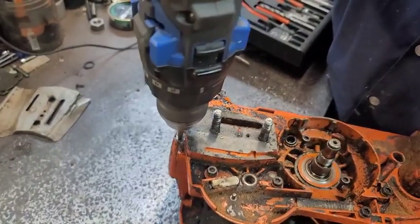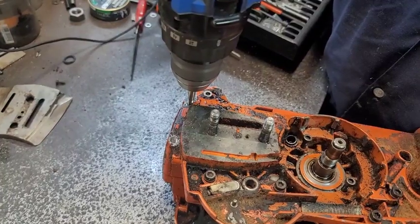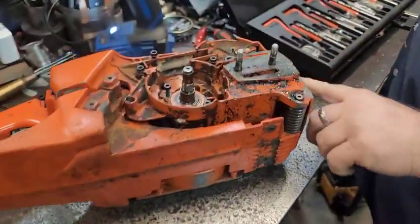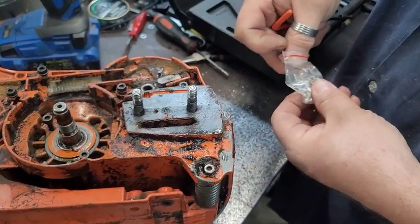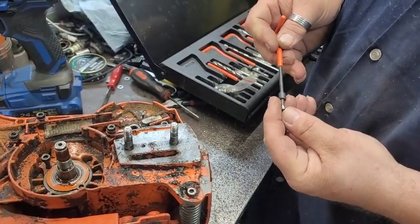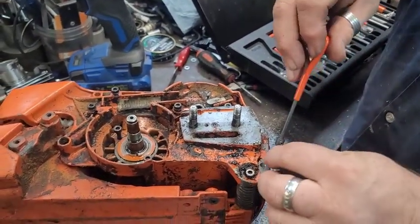I know these cases are nasty, but I wanted to try to get them repaired before we cleaned them — there ain't no point in cleaning them if you can't repair them. I fixed one of these at Simple Man with a 6x100 bolt that I turned into a tap. Now them holes are threaded — threaded for an insert. I know some people are going to say they use TimeSerts or this and that. I use helicoils first; if helicoils don't work, then we go to something else. When you got a lathe you can make your own thread inserts, which is good for extreme cases when you need that custom insert.